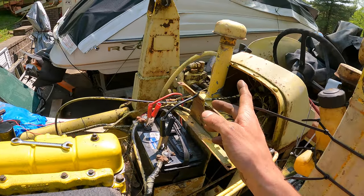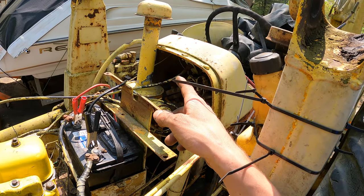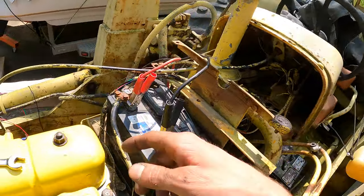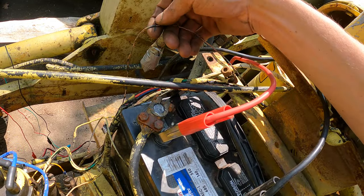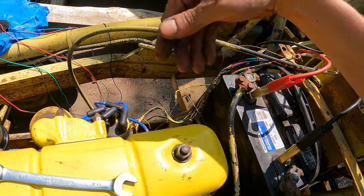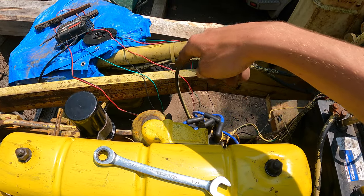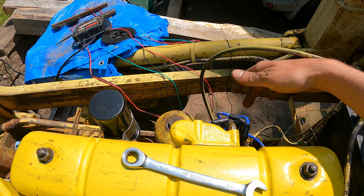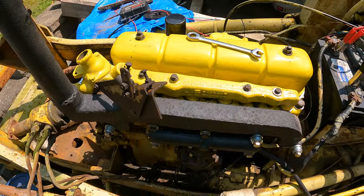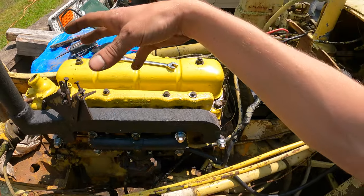And then also on the list is this fuel, the air intake cleaner. That probably all just needs to come out and redo it. And then I had a wiring issue yesterday. Melted this wire, it arced off my janky setup. So I need to at least rewire. I've been using those alligator clips getting by, but I need to at least rewire it here to the coil pack, which is mounted there. I've got the crankcase breather on here too. I guess the valve assembly breather.